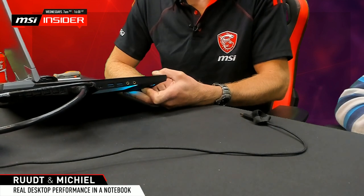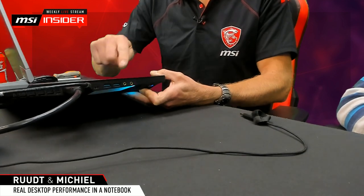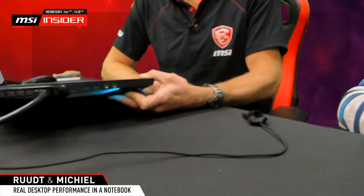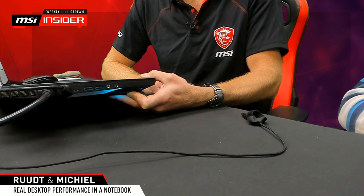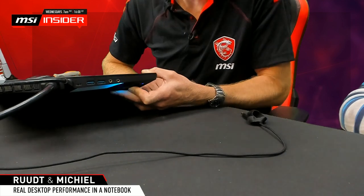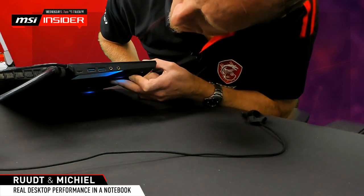Yeah, you can do that. And then we see two USB ports. Oh, it's always complicated with the naming because they changed it a few times. This is USB 3.2 Gen 2, so that's 10 gigabit per second. And I prefer the real name, and it's the SuperSpeed 10. Yeah, so 10 gigabit per second. Exactly, that's the easiest way, so you know what you're talking about. And that's actually on all USB ports on this notebook.